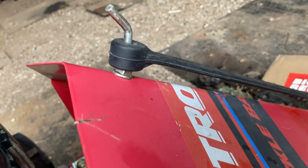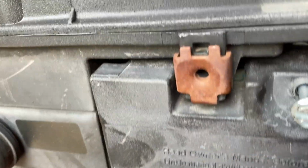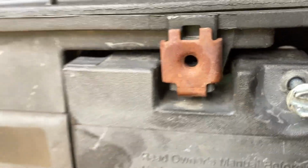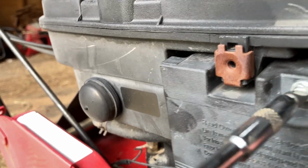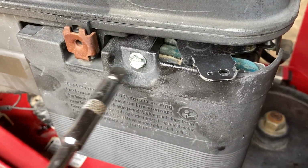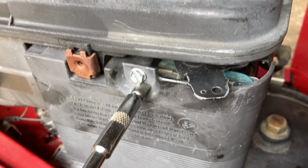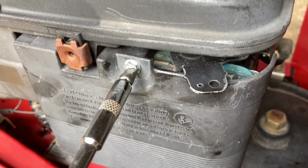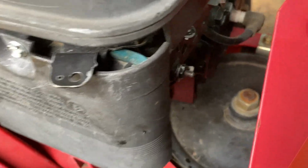But if you wanted to get to the bowl, it is right there. And traditionally they've been like a 7 mil or a 10 mil, but you'd have to find out the specific size for your needs. But for the purposes that it's running and running fairly good, and we're going to be cranking the Seafoam to it, that'll take out any water and dissolve any dissolvables in there. And probably end of season, once we get a rebuild kit for the carburetor, we'll have those rings and we can drop the bowl and give it a good cleaning, but I'm not going to do that until then.